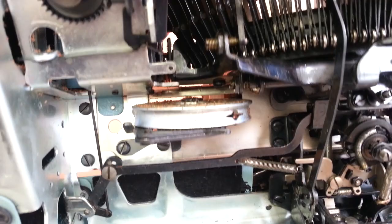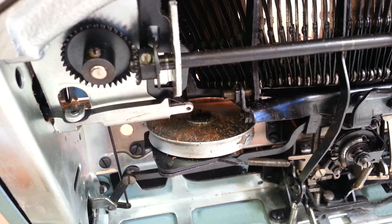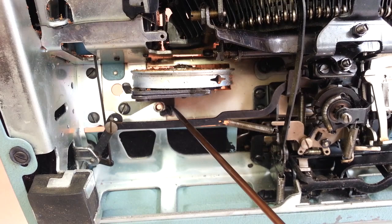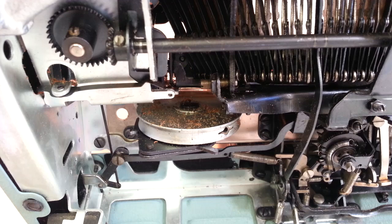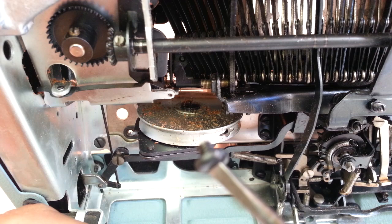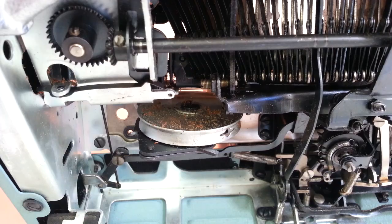There's these two screws right here. I'm going to take it out of the machine and rework it. Now, I realized already that that first screw right there is longer than that screw. Neither one can protrude through the carrier rail there because it interferes with something. So see that one screw is shorter and one screw is a little longer. So if you do this, make sure you're aware of that. Of course, it's kind of hard to put in the short screw in there. It won't actually grab the thread.